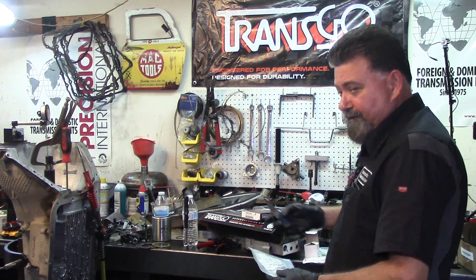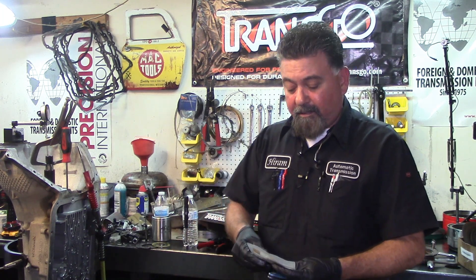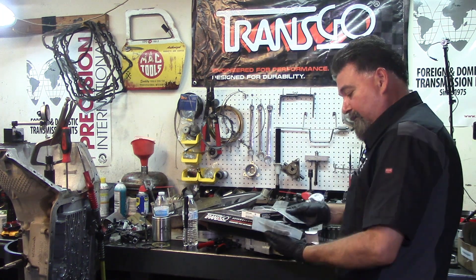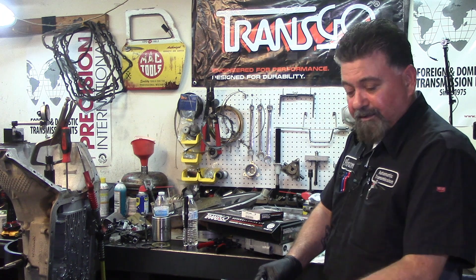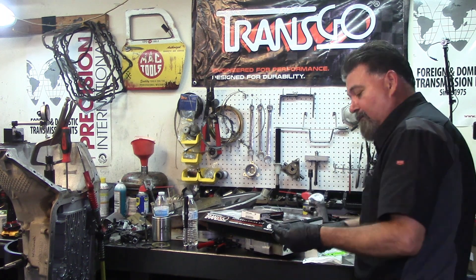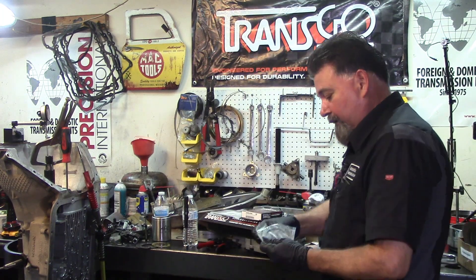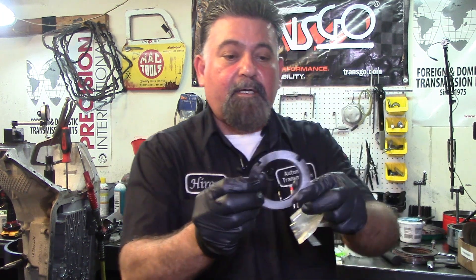This video is going to cover setting up the front end play, the rear end play, and the clearance between the planets. The Sonnax part number is 34006-05. I also have the washer that goes in between the planets - it's a four-tab brass washer that replaces the original plastic two-tab one. You just straighten up the other two tabs, and here are the shims.